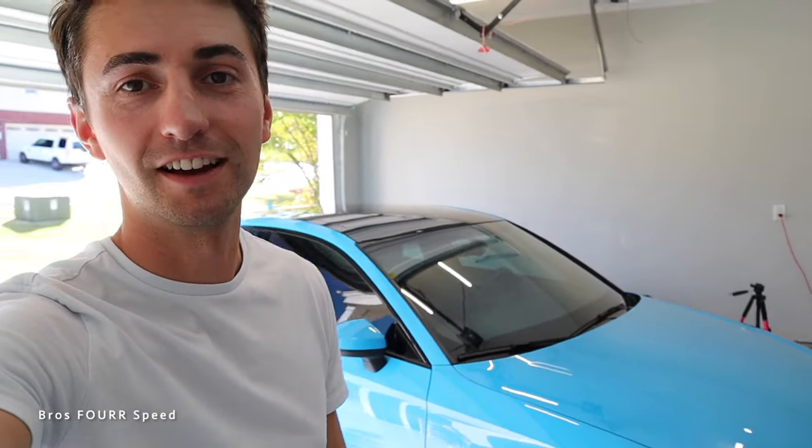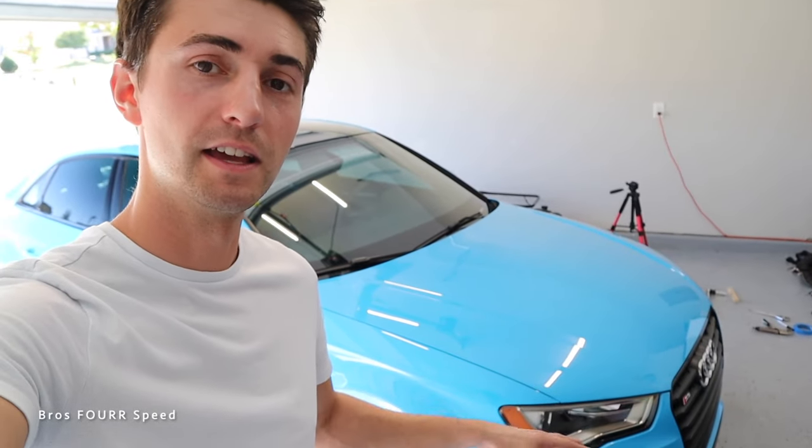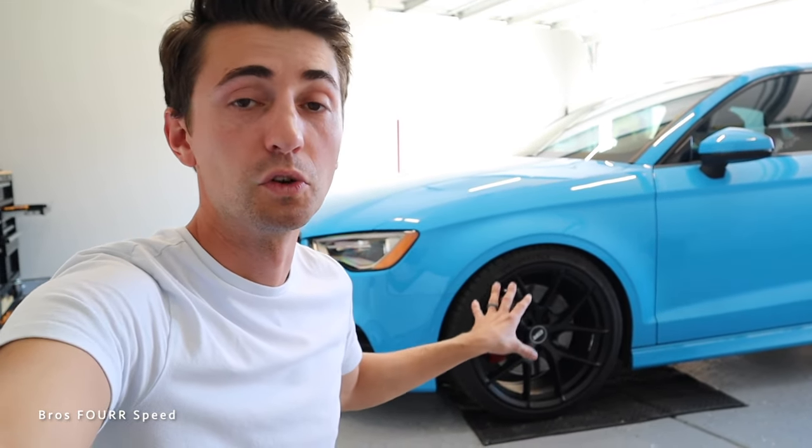Back from the test drive — it was a success. This is a really good tip for those of you who find this maddening: if you get an alignment done and the steering wheel isn't quite straight, that's happened in all of my cars. When I had the Toyota Supra, that's where I first learned about this — after doing wheels and springs, the steering wheel was just a little crooked. Technicians line the wheel straight to their eye, but my eye wants it perfectly level. With one full rotation on both the left and right side pointing the wheels slightly left, we're now perfect.